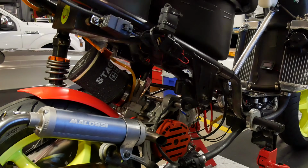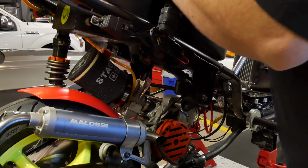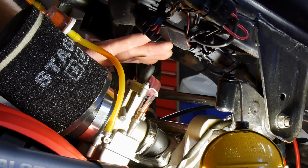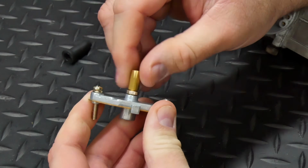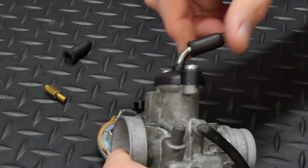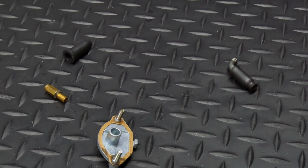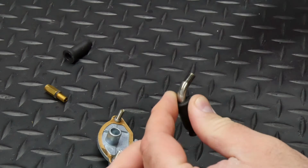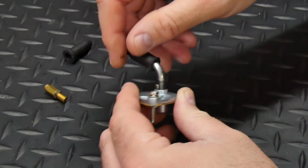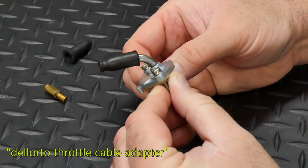Next up, I put the seat bucket on to see if I had enough clearance for the cable or if the bucket had to be modified, and I was happy to find that I had plenty of room. Even though it should fit, I prefer to use a curved cable adapter if the cable is going to need to bend very much, so I removed the cap and switched to the same adapter that I was using on the VHST.